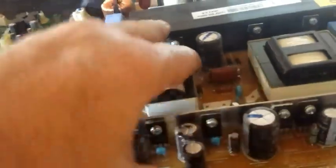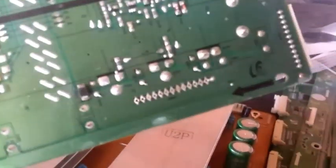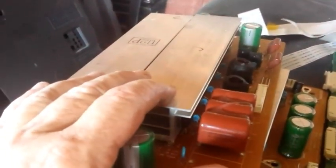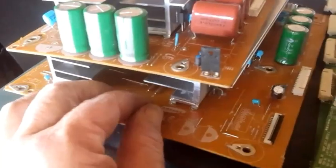There's a big chunk of aluminium there, but you need to be able to use the heat gun to get that off, apart from the screws, which you can see there. These two boards with the big aluminium heat sinks, again, you need to be able to use a heat gun to get those off. But one of those controls vertical, and the other one controls horizontal, your pixels, and they were controlled from this board here,